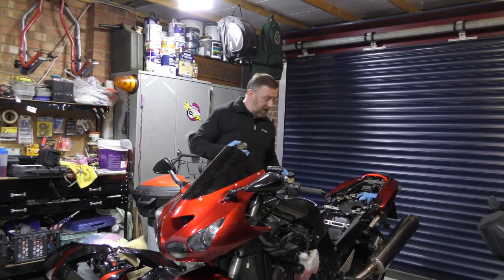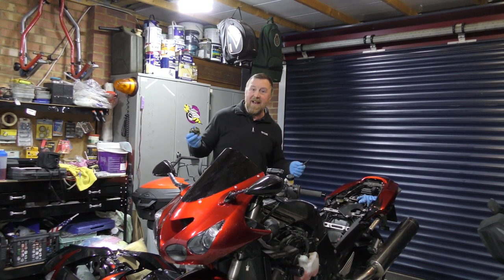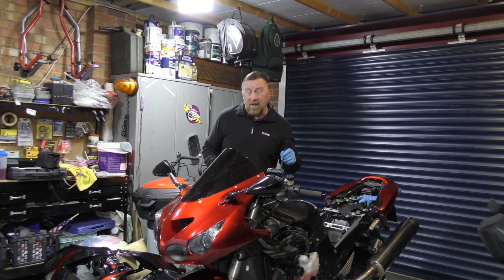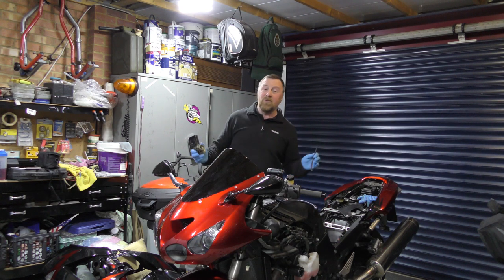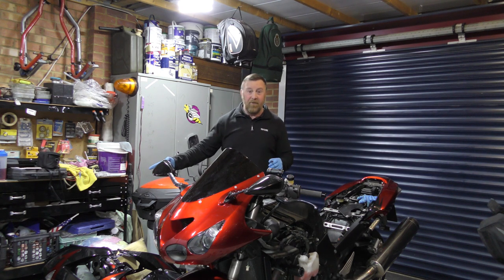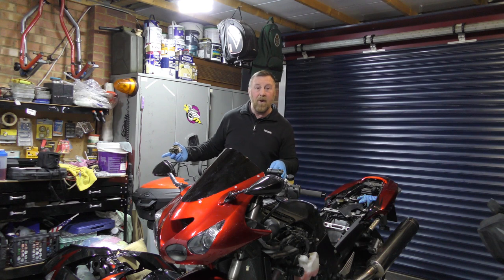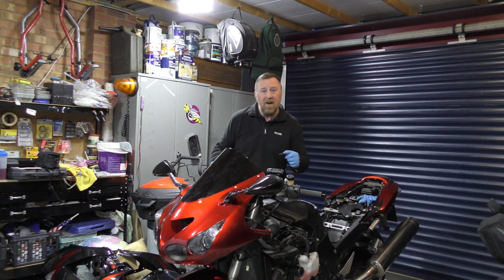There you go. I'm still waiting for all the parts to come for this ZZR. I had to put E10 in it to get me home — six litres. This is a 2010 model, it will run on it. So I'm going to be draining it back out. In my last video I had to fill up with E10 crap fuel — there was nothing else I could do. I had a gallon in there and I put one gallon of E10 in, so I know it mixed with the good E5 super that was in here. I've got two gallons of fuel in there — I'm going to drain it out, because if this is stored up for any amount of time it's going to cause problems. Both my bikes, the Tiger and this, will run on E10 — but I just don't like using it. People are really noticing how bad it is.